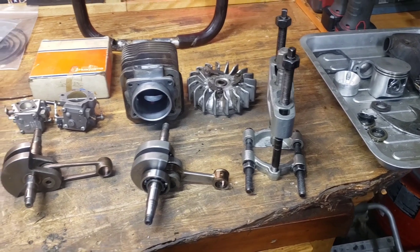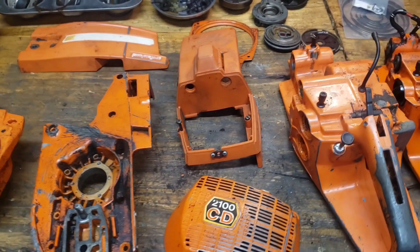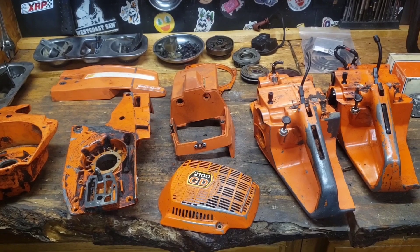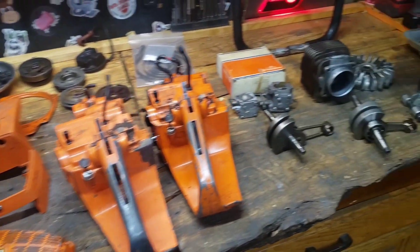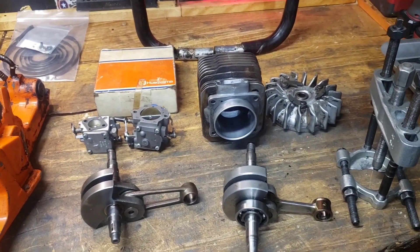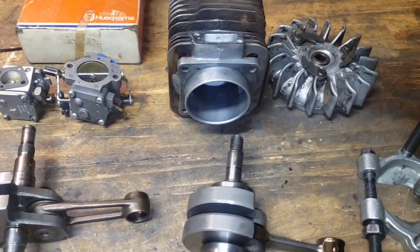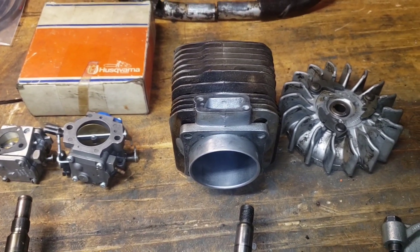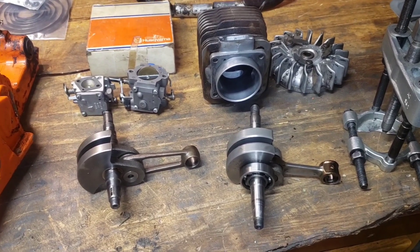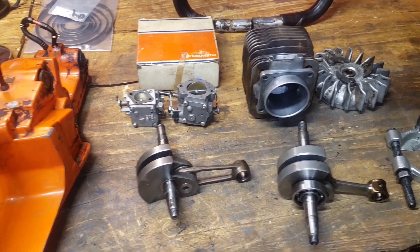It's really quite easy if you've got the right tool. I had to jump on this because I want it ready for the race season, which I believe is in June. I'm at the mercy of another business — my customers are probably laughing at me, like 'how's that going to be waiting on somebody else?' since I'm notoriously late on my own deadlines. I have to send that off — getting it bored out, relined, the crank split and balanced. I'm sending the flywheel also and going to shave a bunch off it to get that balanced.